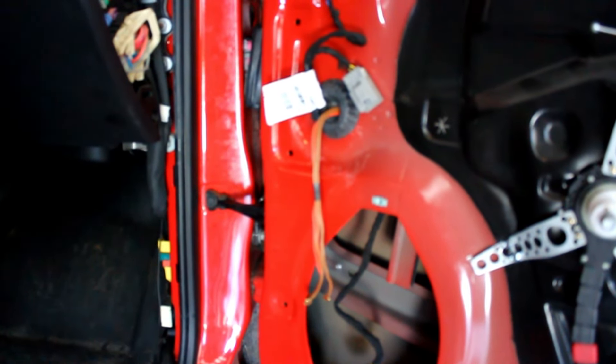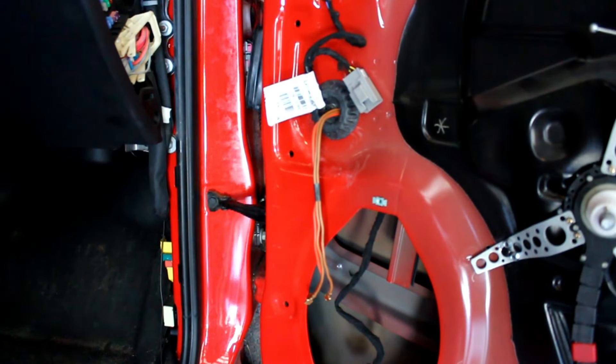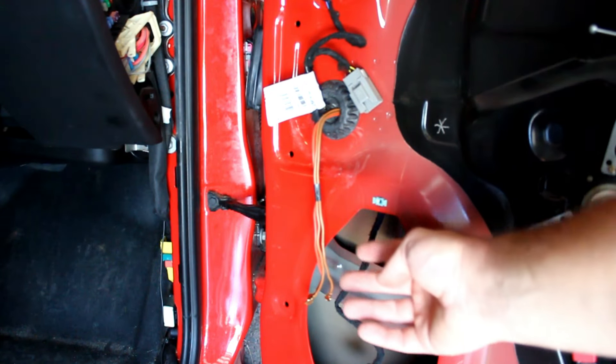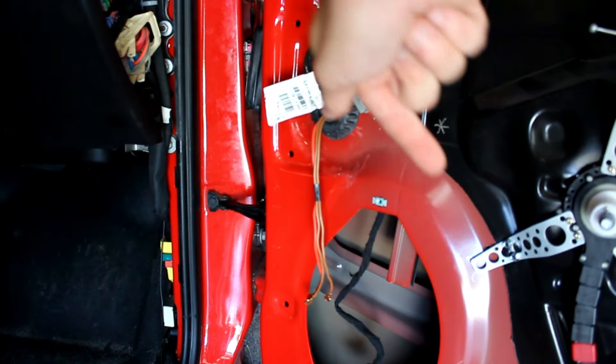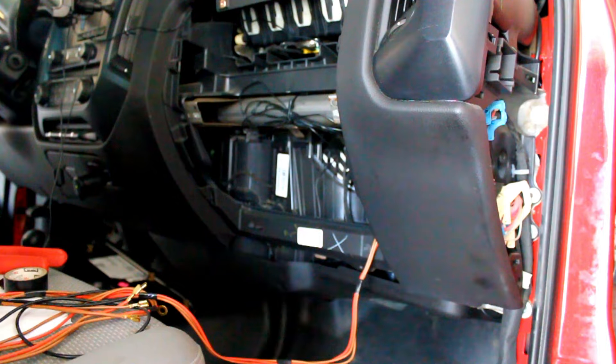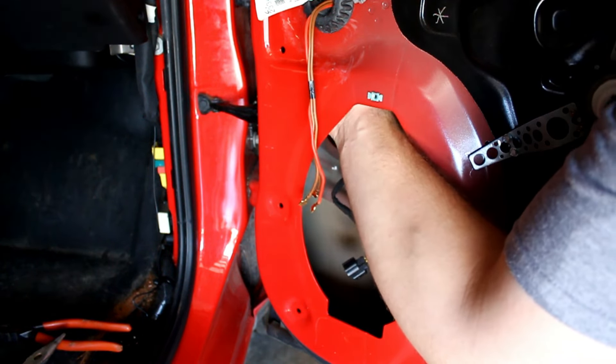Fast forward — I've gotten one wire pulled through the door grommet for the passenger side, and let me tell you, it was a pain. The grommet is hard to pass wires through. I actually had to feed them from the cab into the door in reverse. Getting it through the grommet where the door passes OEM wiring was the hardest part. I used a coat hanger, fished it into the cab, taped the wiring to it, and pulled it through. I had to remove the glove box top and bottom assembly to find where the coat hanger came through.